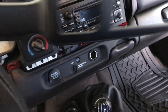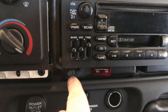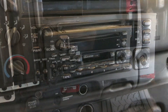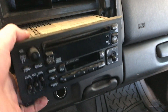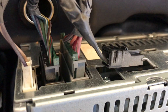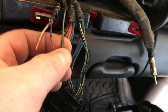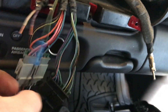The nice thing is you don't have to disconnect any harnesses — this just comes right on out, leaving our radio here. You'll notice we have a bolt here and a bolt here; go ahead and remove those and the radio will come free. We've removed our two 10mm bolts. Go ahead and pull your CD out. On the back, disconnect your antenna and the harnesses on the side — these are held on with little tabs or clips. Here's our ground: this separate black-green wire, we've cut the harness off and wired it into the ground wire we left free.